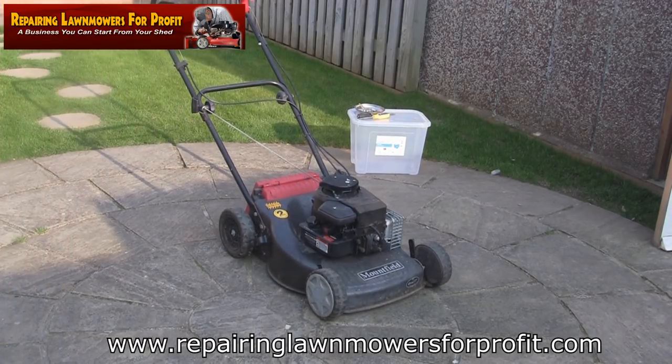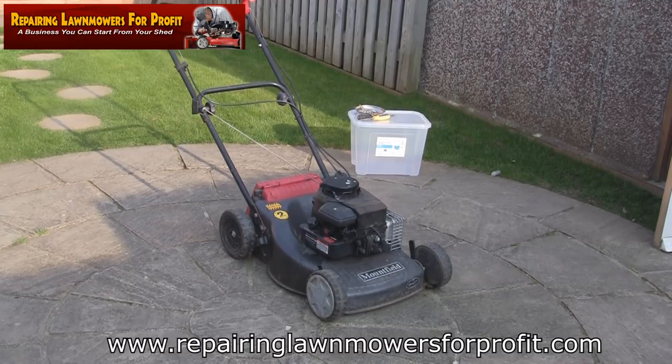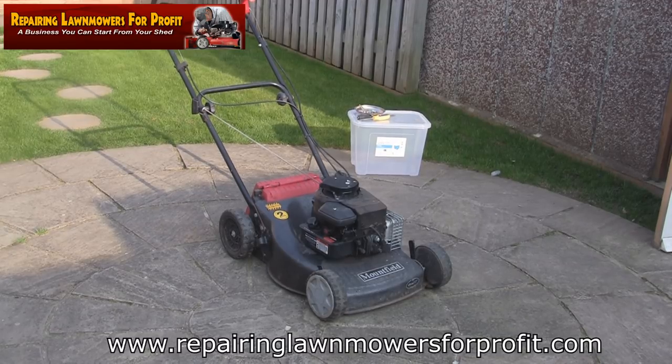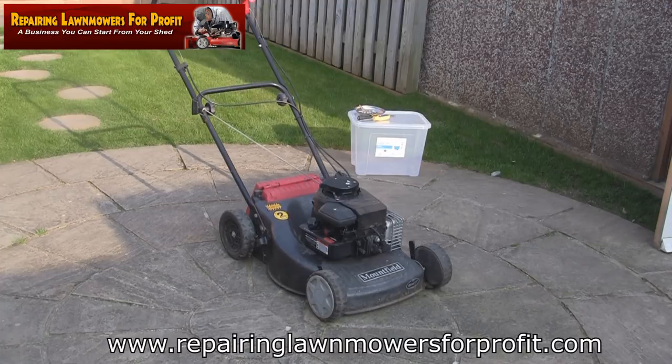You might have noticed on that video I just left it running a little bit just to let some of that smoke run off. All that is is because it's been tipped up - it's just got some oil that's gone into the exhaust outlet. Until it burns it off you will get white smoke. There's nothing wrong with this mower apart from it wanting a good tidy up. I've done the carburettor on it and filmed that for another video. Now I've done the blade underneath. I'm going to clean the air filter, change the oil, put another spark plug in it, and I'm going to list this for £120.